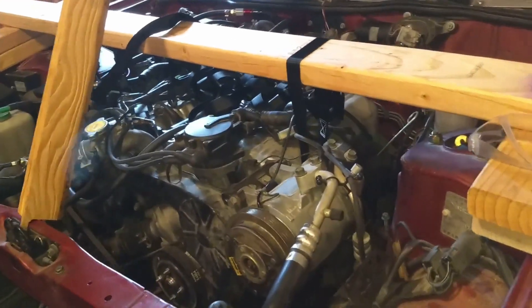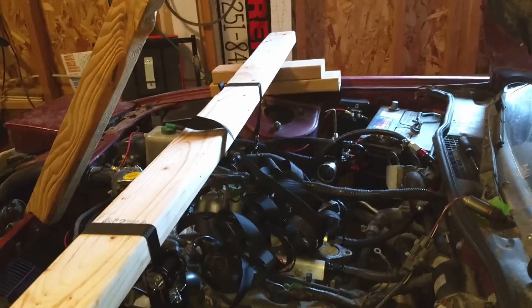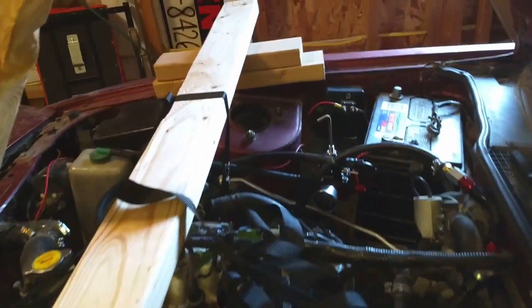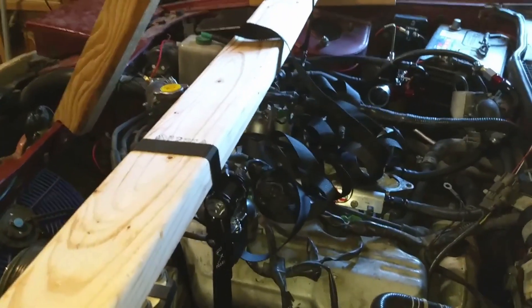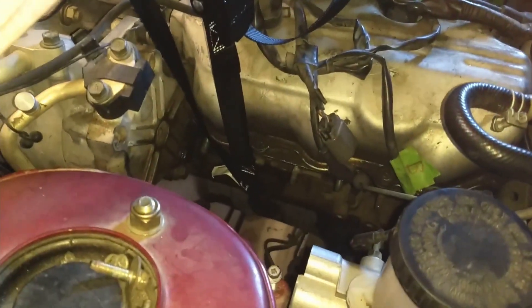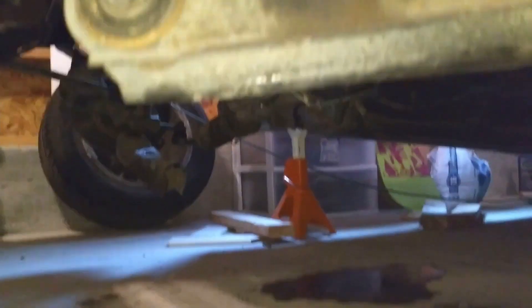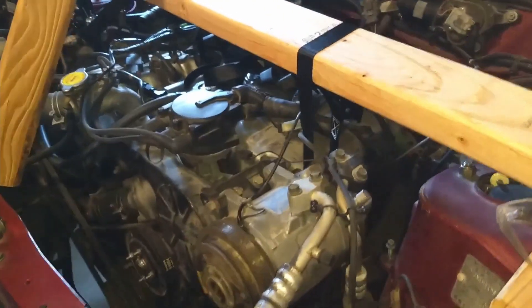The first thing — in order to get the cross member and the oil pan off — I needed a way to suspend the engine. Most people use an engine hoist or something, but I don't have one and I don't have a whole lot of room in my garage. So what I did is I made this contraption out of a two-by-four that goes across the top. There's a little flat spot so it's fairly sturdy, and then I just ran some ratchet straps on a couple points on each side of the engine. Coming underneath the car, you can see it's hanging there. Before I did the ratchet straps I had it jacked up a little with a jack. This seems to do the trick — it's holding it steady.